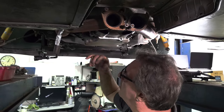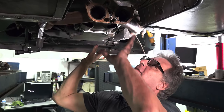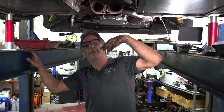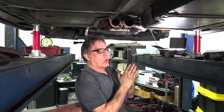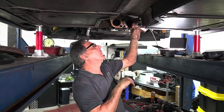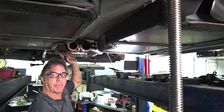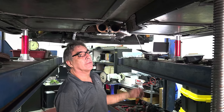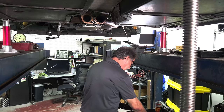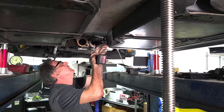There's a bracket holding this harness that I can't get to. We're going to take the support down again — the torque tube is sitting on this, so I want to pull the engine back a little bit. We can only go down so far; the service manual warns about crushing the firewall because it's fiberglass. We have a pole jack here that will be able to lower the engine down, and I think I can get up and unbolt that strap holding the wiring harness. We've got a lot of bolts. I hope you guys don't get bored — we just might get this engine out.